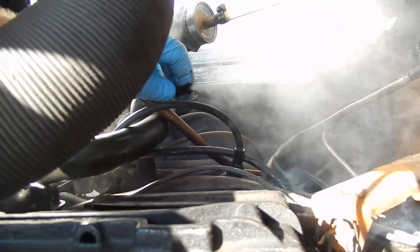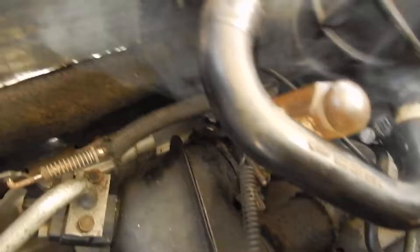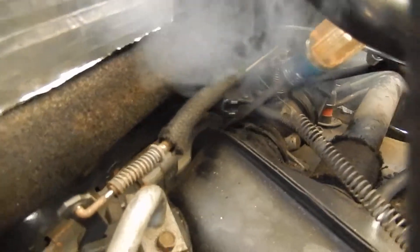See, I've got a massive vacuum leak right here — you see that? Well, that's actually the tube going to the intake plenum, but you see how it works. That's what you want to find — you want to find these little leaks everywhere. Looks like I've got a leak down there somewhere. Where's that coming from? Maybe it's from the S-boot. We'll have to find out though — might just be more vacuum tubing.